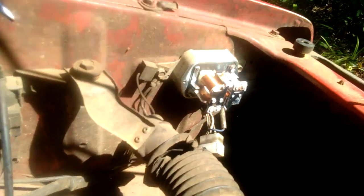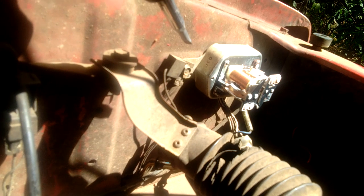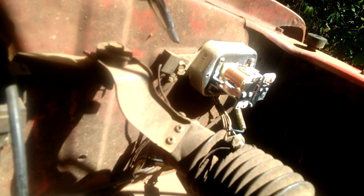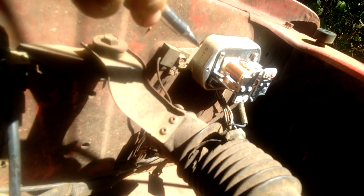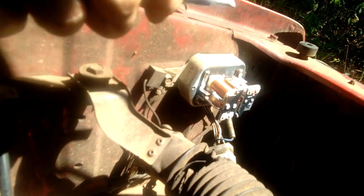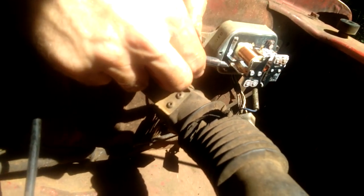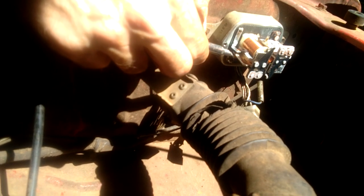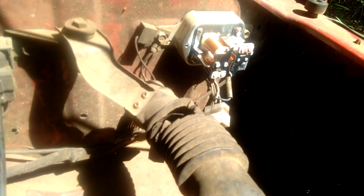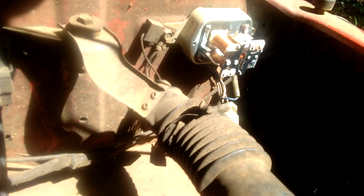This tab right here — I already did this in a video I made just a minute ago but the camera shut off, so I'm not going to redo it all over again. We started out with a voltage of 15.5 volts, and when I bent this tab down a little bit it changed to about 14 or 14.1 volts, which is ideal. The range should be somewhere between 13.7 and 14.5 volts, so 14 is fine. If the voltage is too high, bend it down; if it's too low, bend it back up. I only had to bend it maybe a tenth of a millimeter and it changed the voltage about a volt and a half.